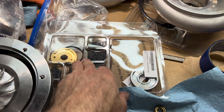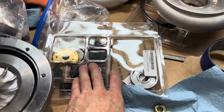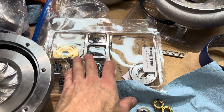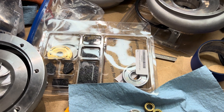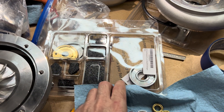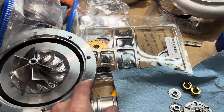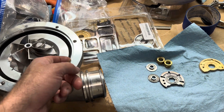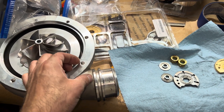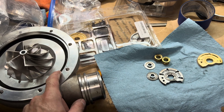I'll leave a link for my rebuild kit. These are all the rebuild kits that we sell — nothing here that we don't actually use ourselves. All these parts come to me and I go through, clean, and inspect them before sending them out to Amazon. I also include an O-ring; if you're willing to machine the bearing housing you can use it, otherwise you can't, but the O-ring seals the compressor housing and bearing housing together so you don't have to worry about leaking there.